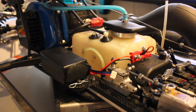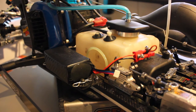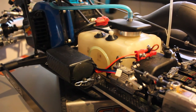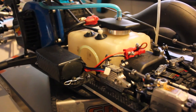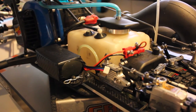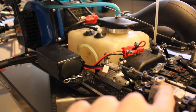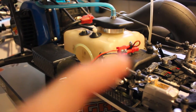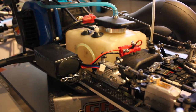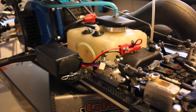Last but not least, the battery — the big block which provides all of the servos with power. This particular one is a LiFe battery at 6.6 volts, but many people use LiPo. You can use any sort of battery you want as long as the voltage is compatible with the servos. If you use a 7.4-volt LiPo on a 6.6-volt servo you will obviously ruin it, so you'll either need a compatible servo or a little transformer to change the voltage to your needs. That's it — I hope you enjoyed this tutorial and see you in the next one.